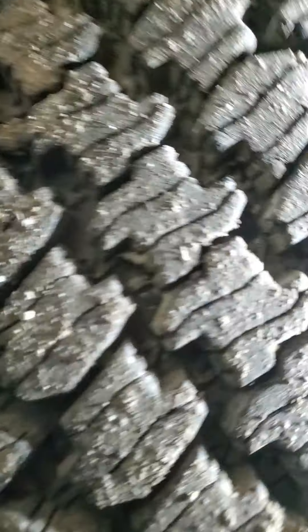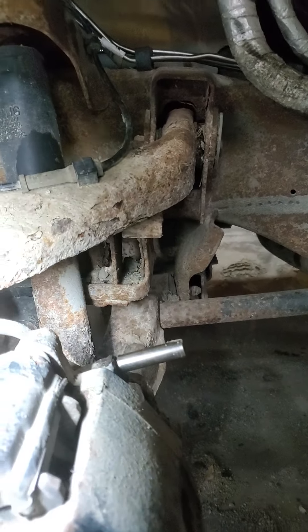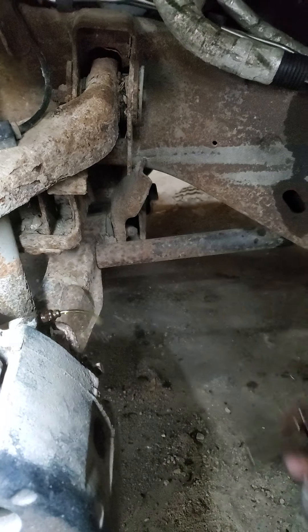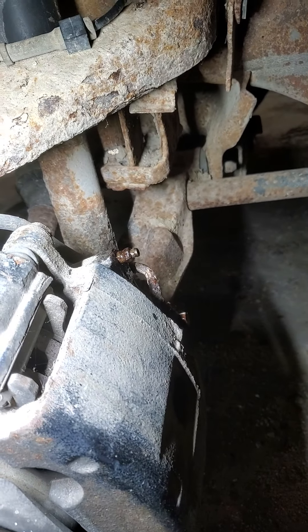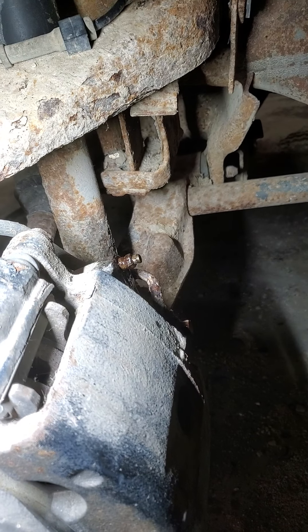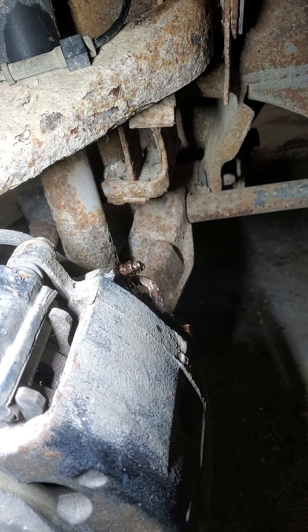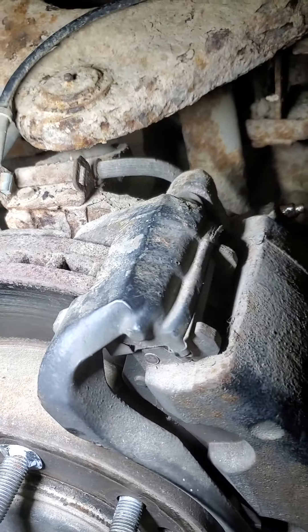I'm not going to film the rest of it, but that's the gist of it. It's going to take me less than 10 minutes to bleed this whole truck. You might go ahead and do it the old-fashioned way after you get done, but this will get fluid to all the calipers pretty quick. You're not wasting time pumping the pedal and wearing your wife — or your helper — out. My wife's the designated pedal pumper. What I'll do when I get done is top the fluid off, pump the pedal, go through it one more time, and it's honestly probably going to be fine. We've got a good solid stream right there. Just that easy. Have a good one.